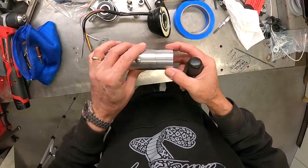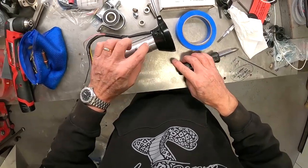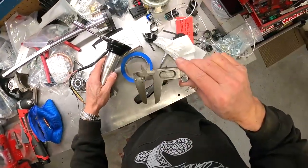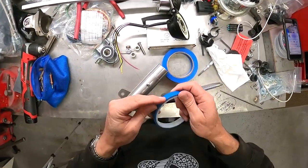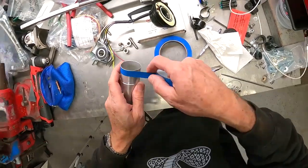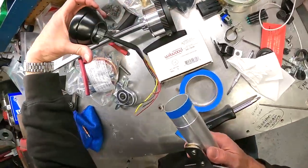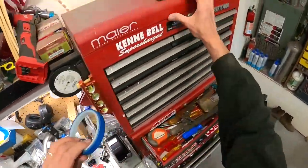Here's what I'm thinking: I'm going to cut this tube off, put this piece on here, measure that distance, and cut the tube off that amount. That way we pick up some space right there. The Delrin bushing is quite a ways in there, so I've got plenty of room, but I can't go beyond this lip or it'll ride on that. That nets me just a touch over half an inch, so I'm going to cut a half inch off this tube. I'll use fine line tape — it's exactly half an inch — wrapped all around the tube as a cutting guide. I'll stuff something down there so I don't get debris inside the Delrin bushing.